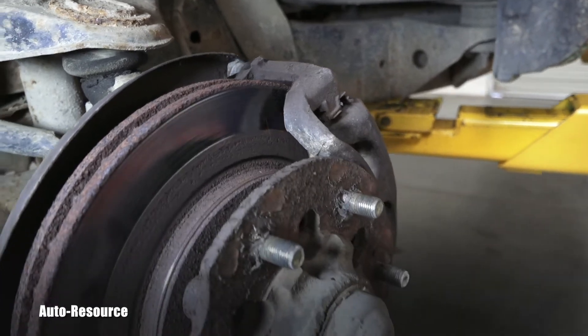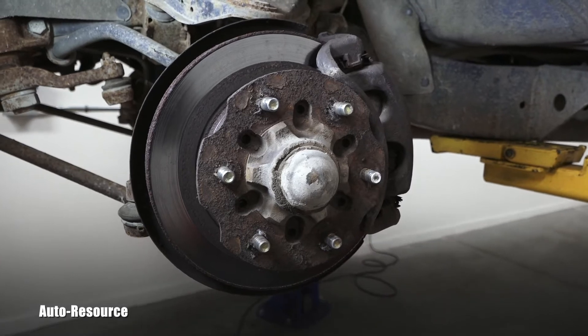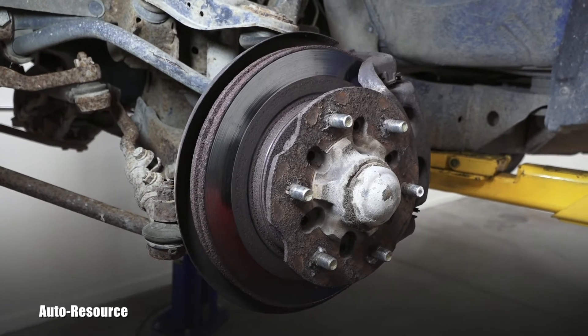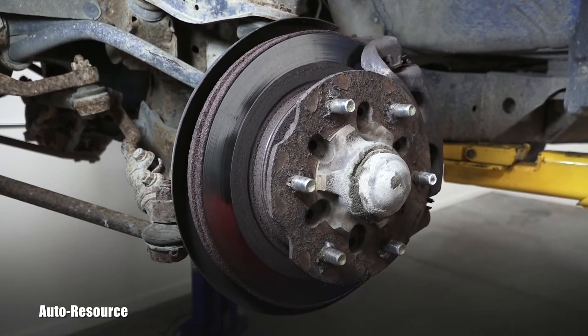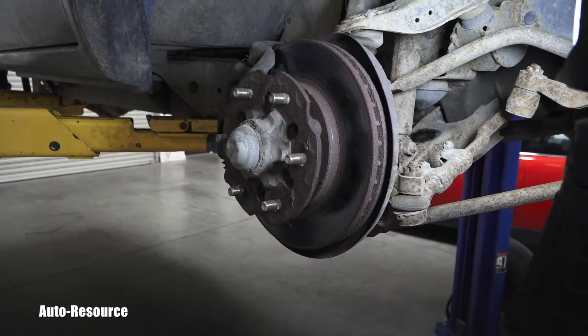There's again basically zero material on those brake pads. I couldn't even fit a one-millimeter gauge. Obviously you want to replace these pads soon, because this brake rotor will be way more labor intensive to replace if the brake pads damage it.